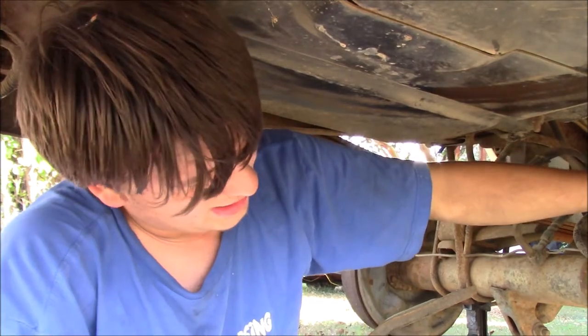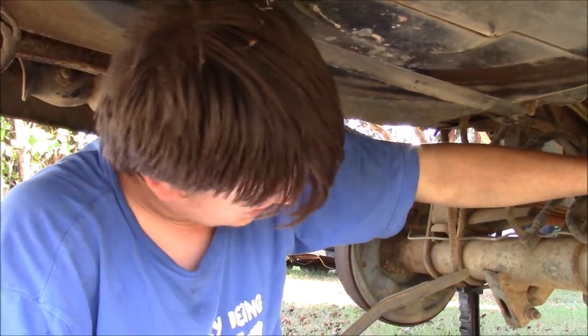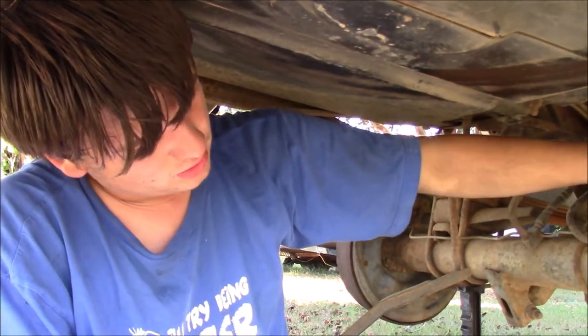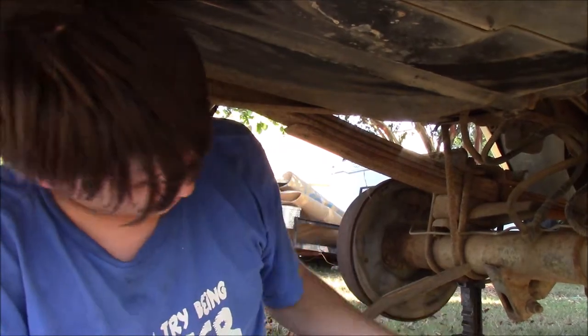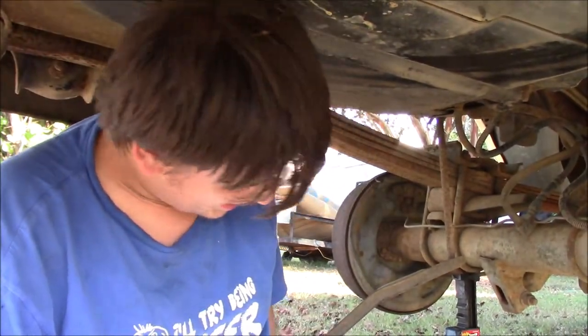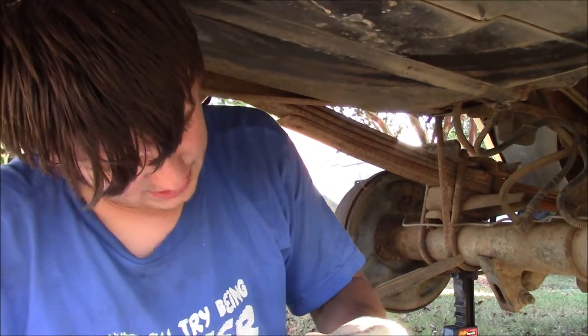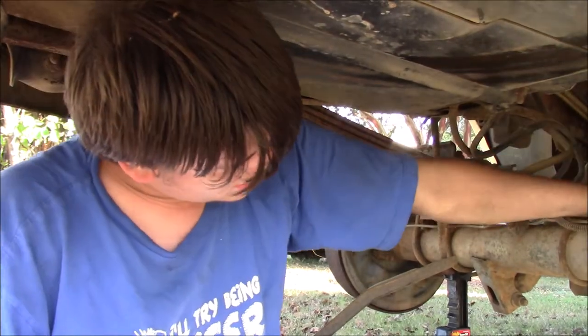So now what I have to do is spray WD-40, run this bolt in and out, in and out, in and out, like 40 times. And I may just go get a donor bolt, one with the same threads, because this one is actually going to be used in the cover, so I'd rather not mess any of them up. But I'm going to have to take all these and get all this gasket material off of them. So this is going to be quite a tedious process.